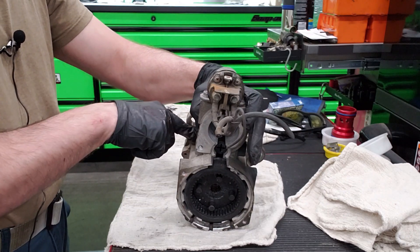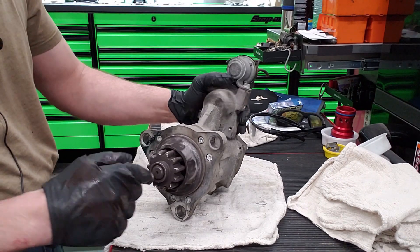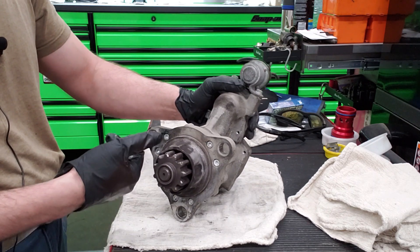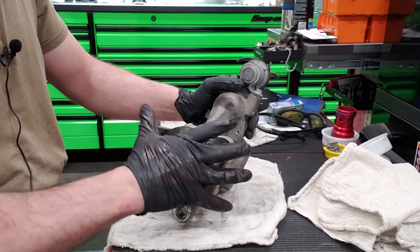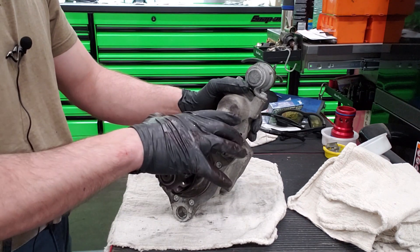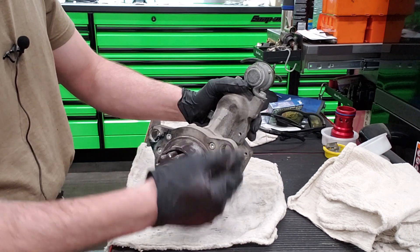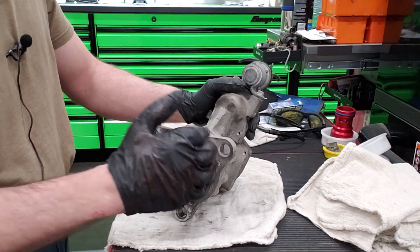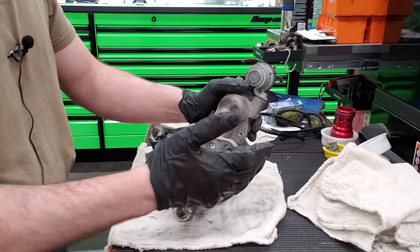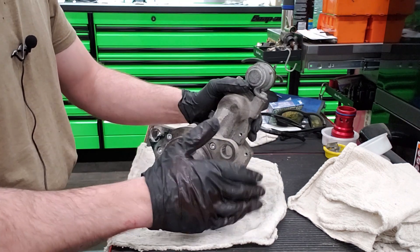You have to dismantle the whole starter just because somebody else didn't pay attention when they pulled the other starter off — you had to re-clock the ring. And re-clocking the ring is pretty easy. It's a T30 — you've got six of them. Zip them all off with a quarter-inch impact, clock it to where whatever you pulled off matches up, zip them all back down and torque them or go over them real good with a ratchet without stripping them off. They hold in there pretty good. And you're off to the races — set it up so you're not hosing over the next guy.